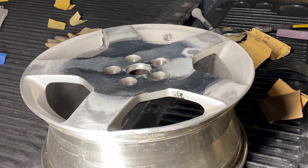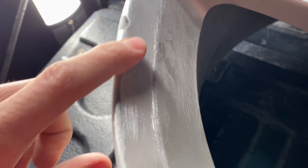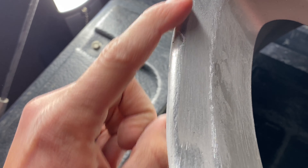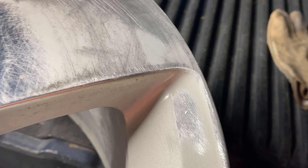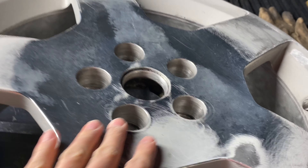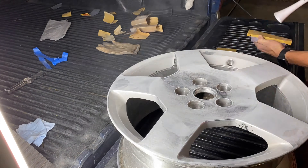There you have it. Right here I fixed - or tried to fix - the big dent. It looks a lot better than it was for sure. But it looks like I did miss a spot where Bondo was supposed to go - right there and right there. Yeah, I missed a few spots, but that's okay. Now we need to sand it all down with 320.